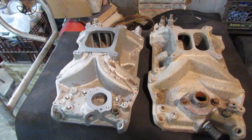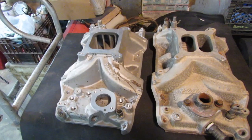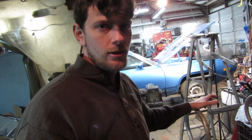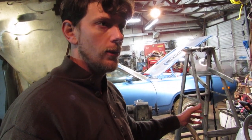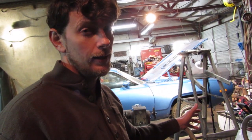Ultimately my goal with this is just to have a great bracket car — be very consistent, low maintenance. After several times at the track I can get it optimized and get everything out of it. I have a buddy on YouTube who always says don't settle for good when you could be great, and that's what I'm going to try for. I'd like to get this car into the high sixes in the eighth mile. With around a 600 pound weight difference from my truck, that could be around five or six tenths right there. The best I could do in the truck was about a 7.88, so six tenths off that I'm already at 7.20. I'm adding compression, a bigger cam, better flowing induction, and may step up to an 850 CFM carburetor. All those little things add up and can eventually get you a lot faster. Hopefully this is helpful to someone — I appreciate y'all watching and I'll catch you next time.